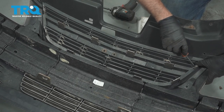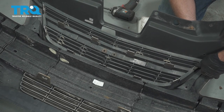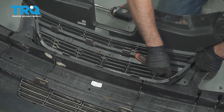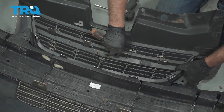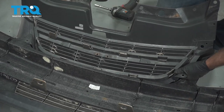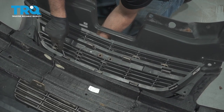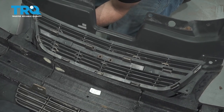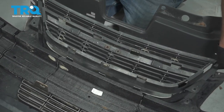This whole cover is clipped in on the sides — you can just try to slide those out. Put a little pressure on the grille from the front side, just use a straight blade screwdriver and try to push these clips back while you're slipping it out. Just be careful not to break them. And that's all unclipped — just carefully slide this out and out of the way.